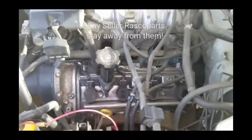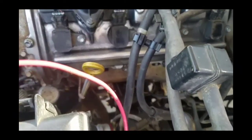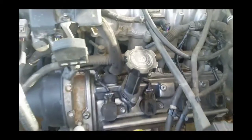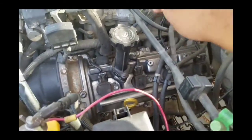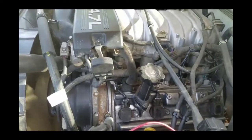This is another view of the engine. The knock is coming from within the engine — and that's a rod knock. It's just going to get worse.